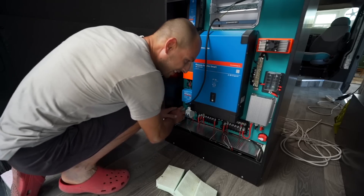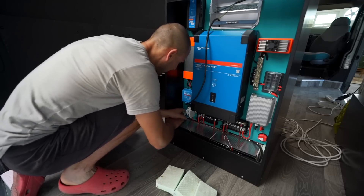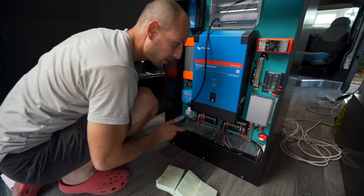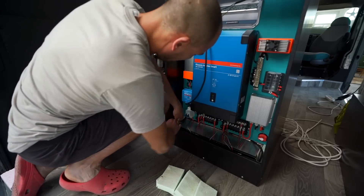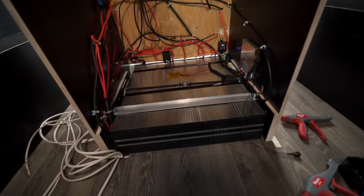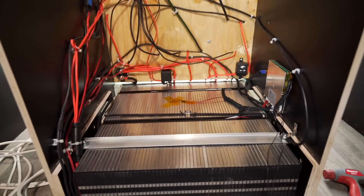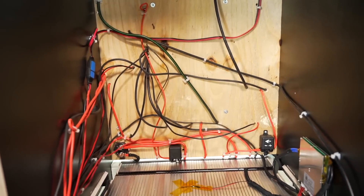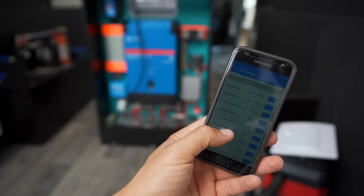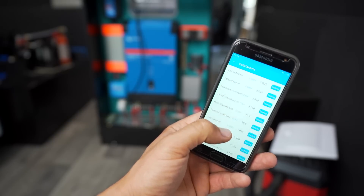That is a tight fit — that's not going anywhere. This will also work as a buffer; it will squash a little bit but it doesn't go hard and it's not going to destroy anything. Battery successfully installed, properly attached to the chassis of the car. BMS installed and set. These wires are a mess that needs to be organized later on. BMS seems to be all set — all the values look good and I think we are moving towards pressing the ON button.